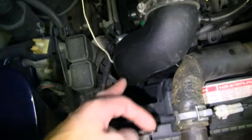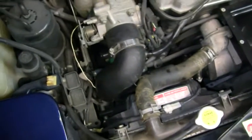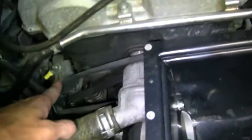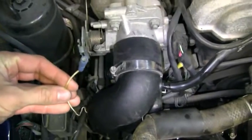And as you can see down in here, the intake air, the idle air control valve hose, I've got that all hooked up. So now I'm just hooking up the wires for the intake air temperature sensor, and again, this is specific to the Link ECU. The one wire is the black wire, and we just grounded that. It's just a ground, so we grounded that right here to this engine ground where a couple other things are grounded.